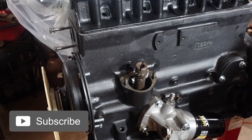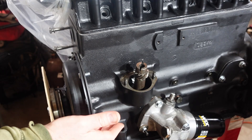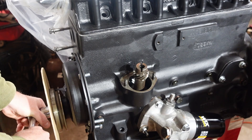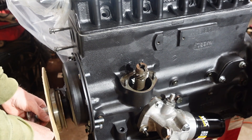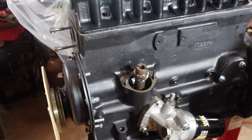That's where they're engaging with the camshaft gear, but that's probably not as far down as it can go. So we're just going to slowly rotate the motor and you're going to see this thing drop down when the oil pump lines up with this tooth in here. Now it's spinning because it's engaged with the camshaft — and there it just dropped down. So now that's in with the oil pump.